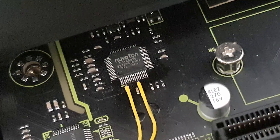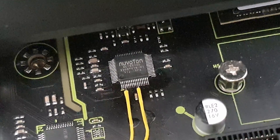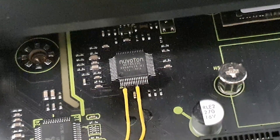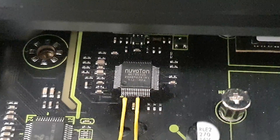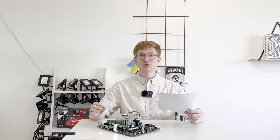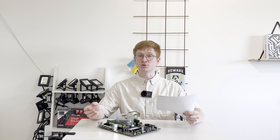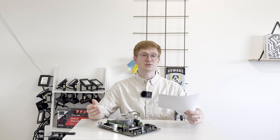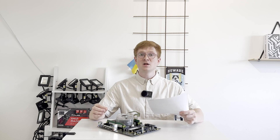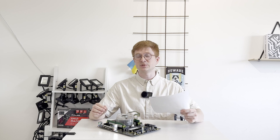Unfortunately, because Chinese boards did not trace all required connections to the JLPC-1 header, it is required to manually solder two additional wires from the TPM 2.0 module to the Nuvoton controller. These two additional wires are required for TPM 2.0 module initialization during a system reboot. Your TPM 2.0 module will work without these additional wires, but if you reboot your system it will fail to initialize. So if you don't want or cannot connect these two wires, you have to turn off and then turn on your computer — do not reboot it — and it will be just fine.